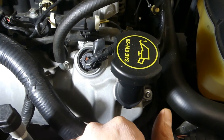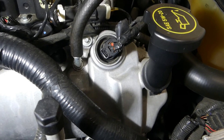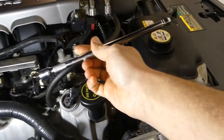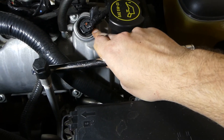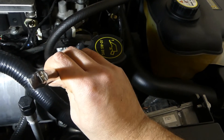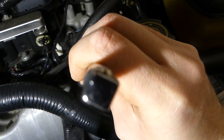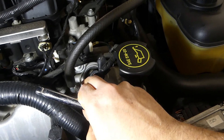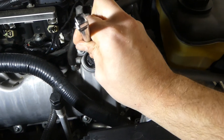At that point I'd say just wait until you do a timing job. But here's one installation tip — just pretend this is one of the seals. When you go to reinstall the seal, you need it to seat down into the valve cover. What I did was I took a half-inch extension, seated the VCT seal right in after installing the solenoid, then put the extension on the edge and went around with a rubber mallet tapping it, working my way around the seal so it would evenly seat. If you use a flat blade screwdriver you risk indenting or splitting the seal. Use a dowel or an extension and work your way all the way around — it worked great.